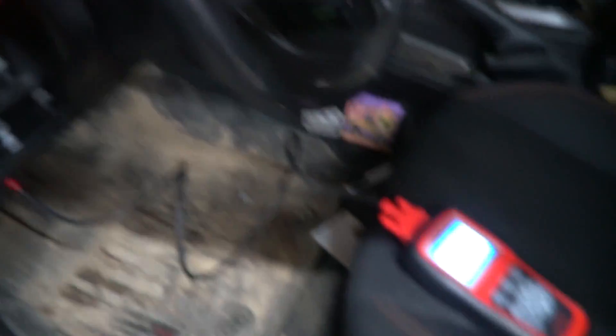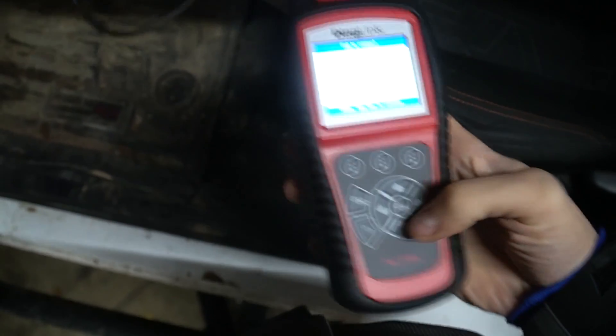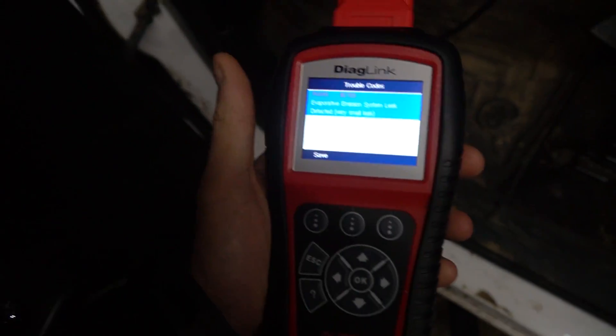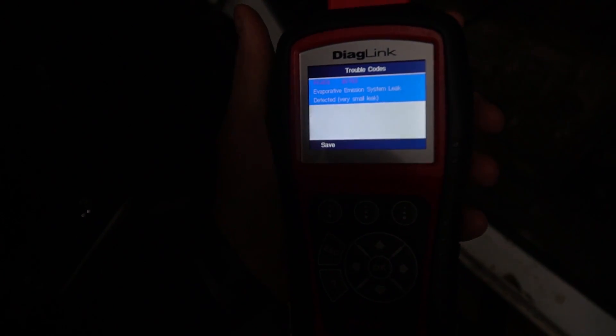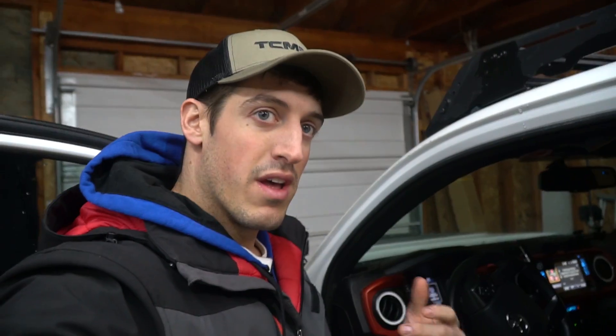I'm not really sure if I need to power the truck on or not, so I'm just going to mess with the settings here. It says it's linking the vehicle — and I got a linking error. I'm pretty certain I need to at least turn on the accessories. Let's see if that works. I'd like to avoid turning the truck on because it's going to scare Carol. Status: one code found. There's the answer — the problem I'm having is an evaporative emission system leak detected, a very small leak. That's why all the lights are on and the traction control turned off.